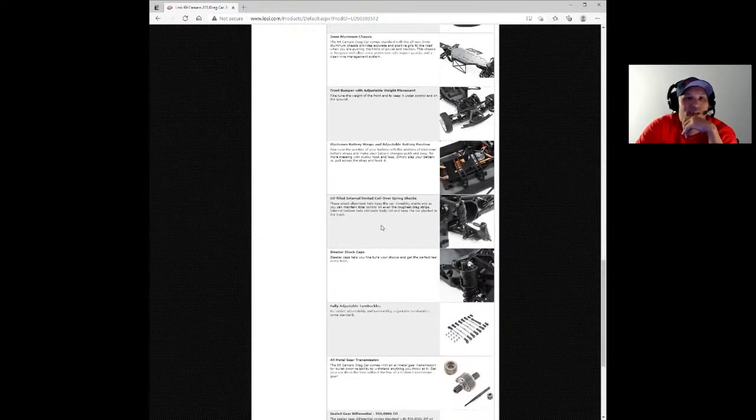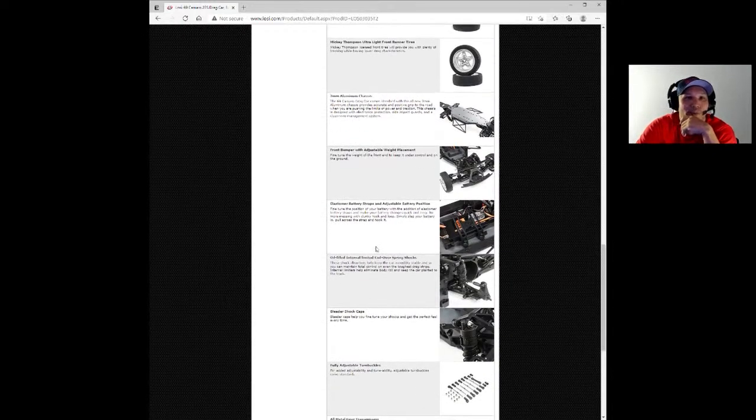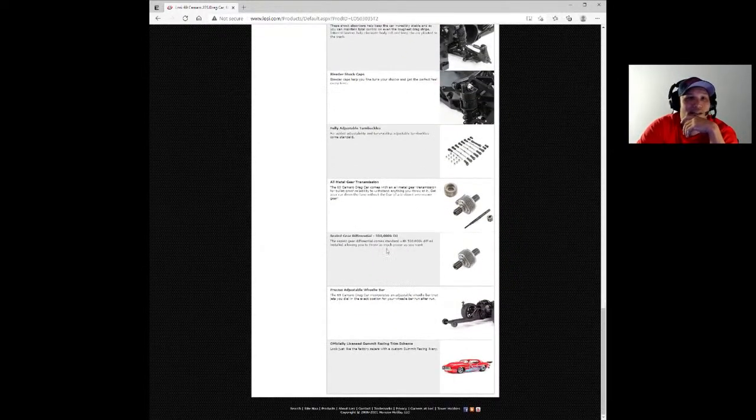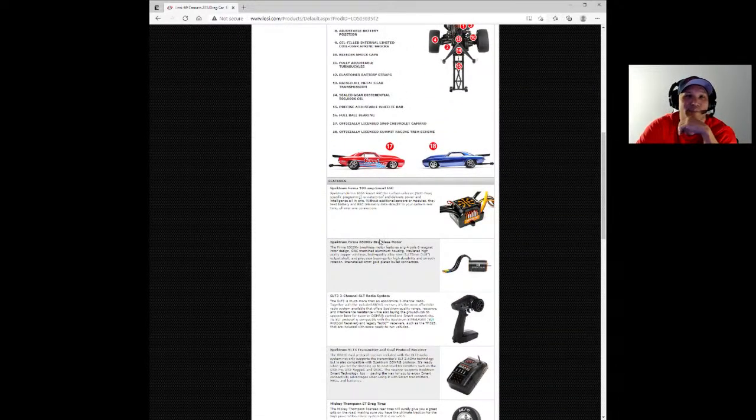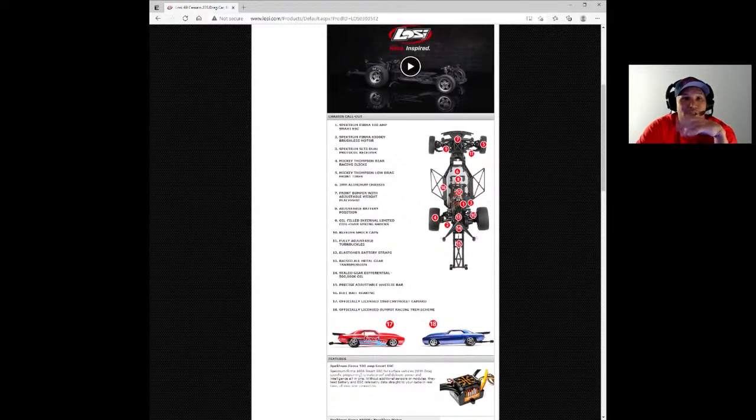So yeah, you can do 100C, 1000 milliamps, LiPo battery, 3S, or you could go 50C, 2000 milliamps, 3S. I think 1000 milliamps, 100C. If you can get a 1000 milliamp, 100C battery, that'd be perfect because it's less weight than a 2000 milliamp. So it would make a big difference. You probably get a quicker top speed, reach top speed a lot quicker and faster.